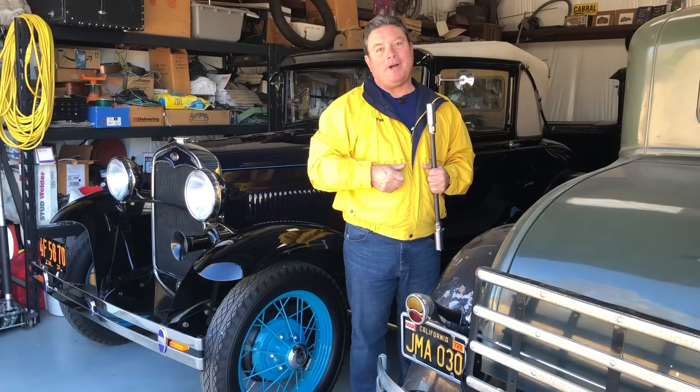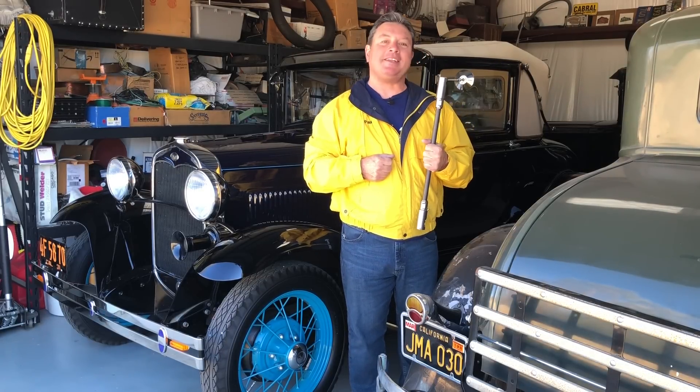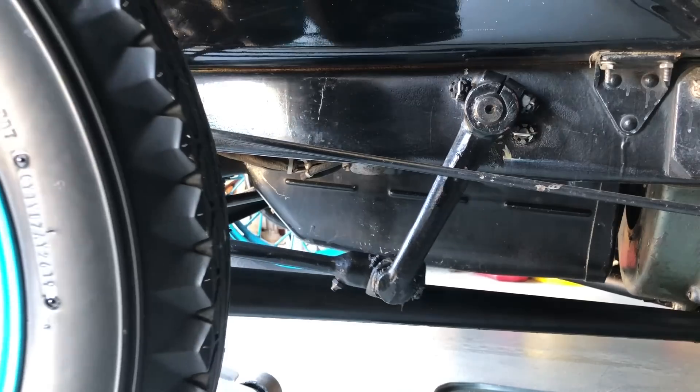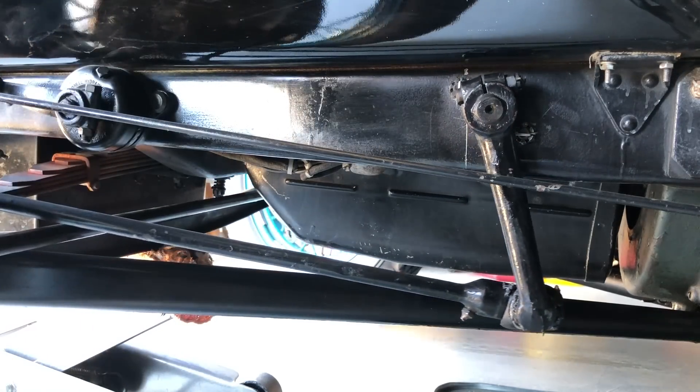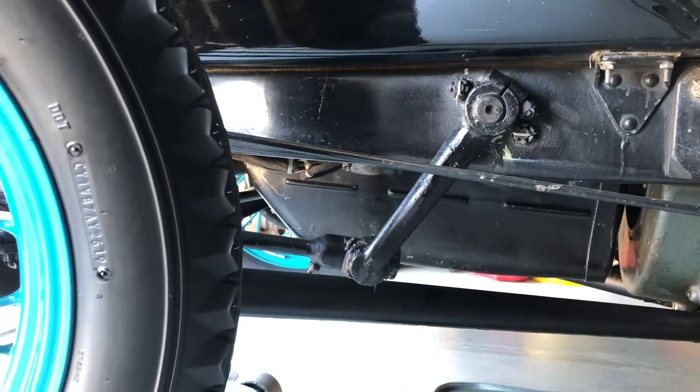Welcome back to the Boomer Box, where it is a chilly 29 degrees this morning. So what is a drag link? A drag link is a very important part of the Model A steering. It's what connects the Pittman arm — that's the little arm that sticks off the bottom of the steering box — to the front end of the Model A. It literally connects your steering wheel inputs to the car. Extremely critical, and its length is critical as well.